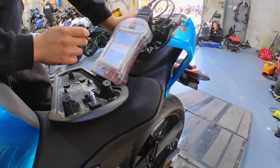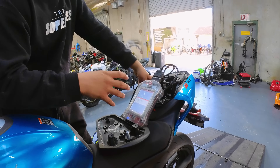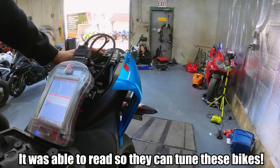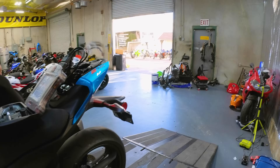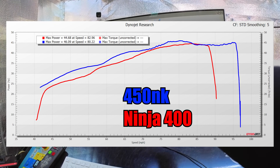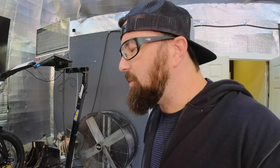The tuner is capable of flashing and tuning these bikes, 100%. And for people worried about warranty — if we can read the stock original tune, that means we can write the stock original back. The blue line is the CF Moto and this other line is a Ninja 400 on the same dyno. That's actually really good — it's hanging on top the whole way up. With some tuning, you could probably pull even more power out of it on stock.